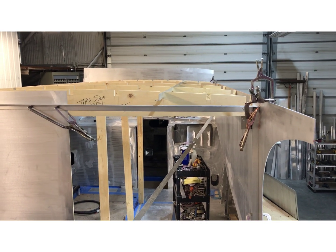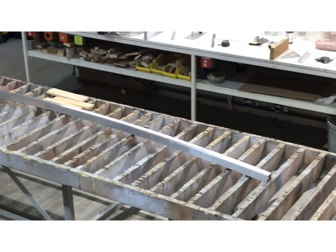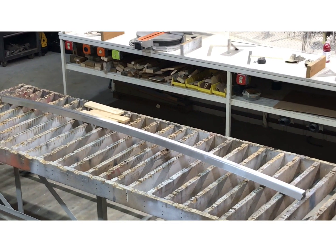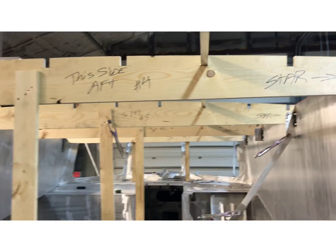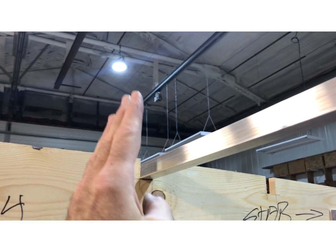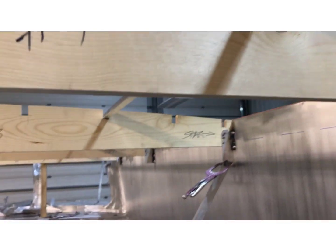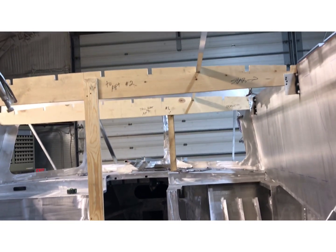I have the bent pieces down there that I rolled over at Kevin's shop — they're three inches of gain to the center. They'll go side to side, every two feet. It'll be like a lattice because these run every 12 inches. These are aluminum angle and they'll be insulated inside. Then I'll rivet plywood with stainless rivets — quarter inch plywood to the bottom of that — then put Naugahyde to finish it.